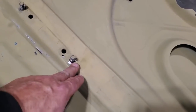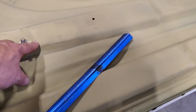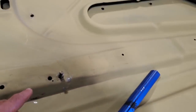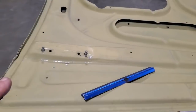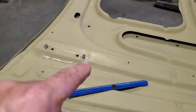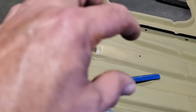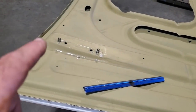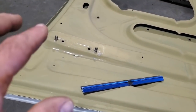I was up doing adjustments on this hood fitting it on the car and this end up happening again. I straightened it up and then we bolted the hood on and it kinked again. So the problem you've got is it's just going to keep doing it. This metal here is 20 gauge - the inner structure - once that happens it's kind of hard to fix in terms of just trying to straighten it up. You can cut this out and weld new pieces in, but the problem I've got is that these studs are in a location that I don't want to disturb.